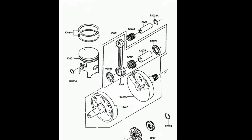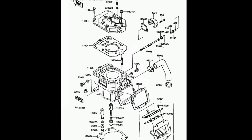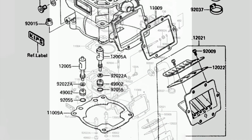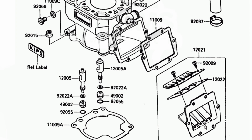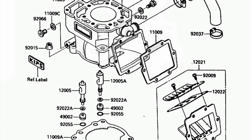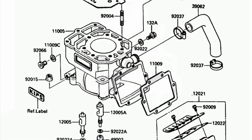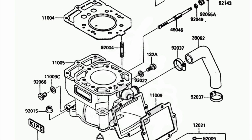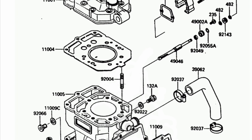This new 67.4 mm by 70 mm configuration was designed to boost the tractability and torque of the KX's already excellent low-to-mid power band. For 1987, Kawasaki also wanted to get their tractor of a motor to pull farther on top, so they redesigned the KIPS slightly to provide better breathing and quicker response. Both of the KIPS valves and its associated parts were enlarged for '87, and the material of the valves itself was changed from steel to aluminum. The gears were also changed to plastic to further lighten weight.